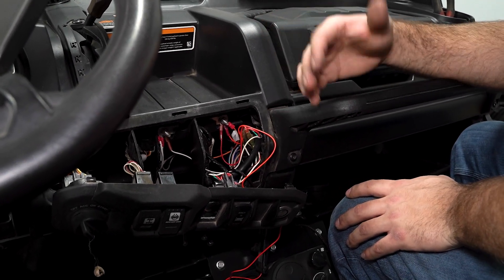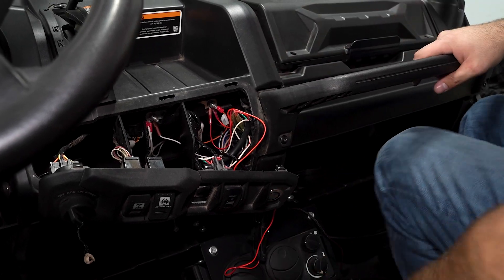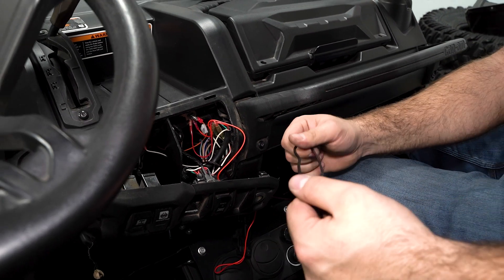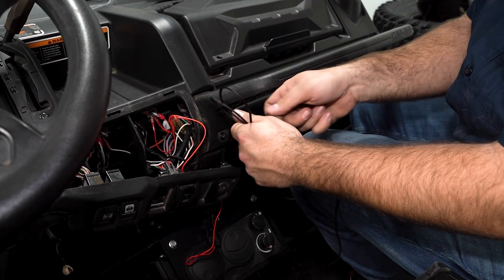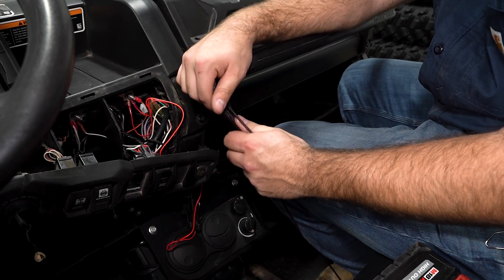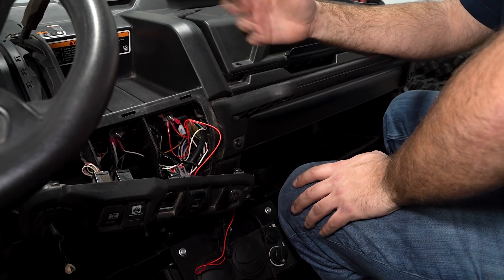Now with all of your wiring, you need to tidy it all up — you don't want to let it hang and droop down. When we talk about cleaning wire up, you don't want to fold it over real tight and then zip tie it real tight. What I like to do is make a nice loop about like that and just keep rolling it, making sure you keep nice loops. Then throw one zip tie in the center — you still want to be able to move these wires, we're just keeping them from falling all over the place, not cinching them down. Tie it up out of the way in a nice secure location where you know it's not going to make contact with the shifter or brake pedal or anything like that.